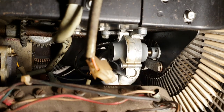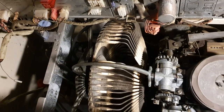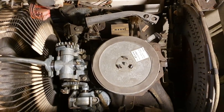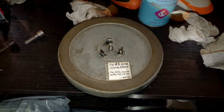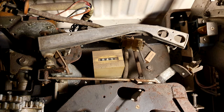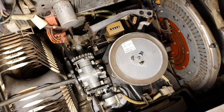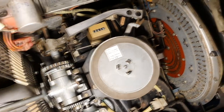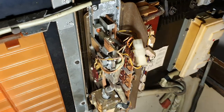One carousel motor back in position. That's the two most likely things to cause a circuit breaker to pop that have been cleaned and sorted out now. Next up I'm going to give it a bit of a cosmetic cleanup inside — there are decades of dust, grime, grease, and general crud. A bit of squirty foam cleaner should help bring it up. Now that's given the mechanism a bit of a cleanup, the next thing to do is turn our attentions to the electrical bits, not least of which all these little contacts and switches.